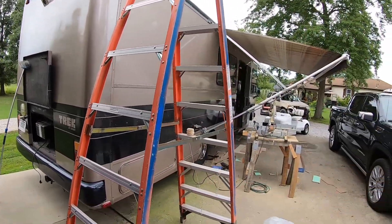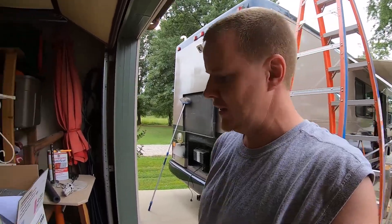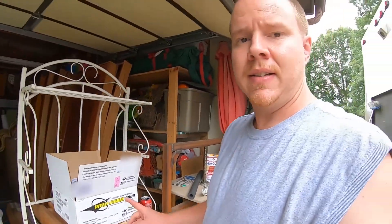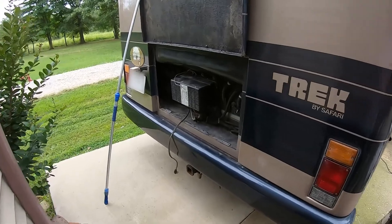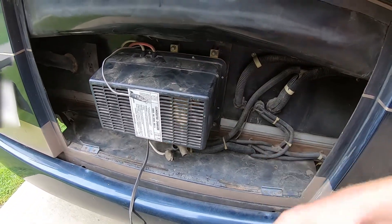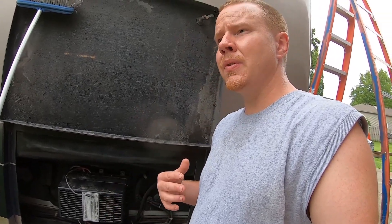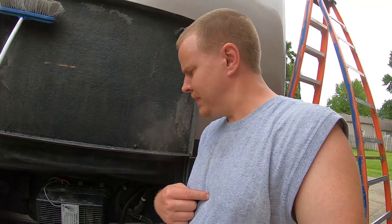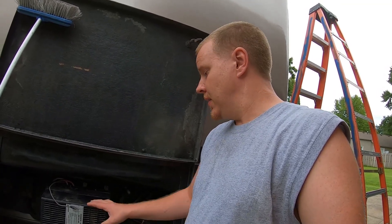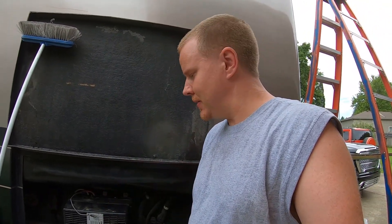We just got here and they're inside redoing the flooring, so we're going to get started on the electrical. This is the unit I've got — it is a Progressive Dynamics Intellipower 9200, 60 amp output, and this is the big bulky unit we're replacing. This is a 50 amp unit, so I'm going to verify wire sizing and make sure we're good. I was going to replace it all with the same all-in-one unit that's in my bus with the fuse panel and breaker panel, but that's a lot more work. I can just swap this charging unit out, which is the main concern.